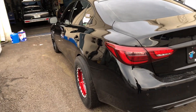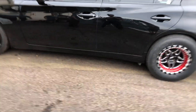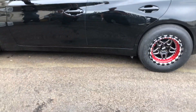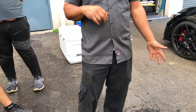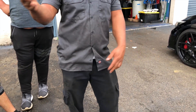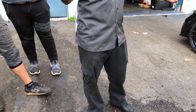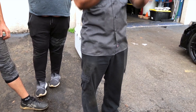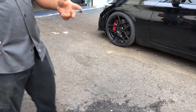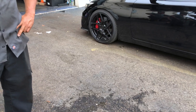We're gonna see if maybe it's the corner balance. Was it corner balanced? No — that's the only thing left. You can feel it: when you step on it, it kind of wants to go a certain way. Even before that with the Michelins it was something crazy. Going from one to 60 the car was pulling to the left slightly, but not as much. My car pulls too — that's why I said to corner balance this, because these cars just like to pull to one side when trying to go straight.